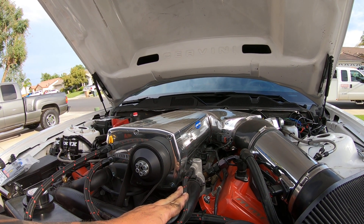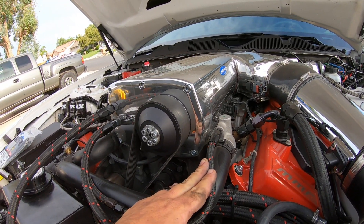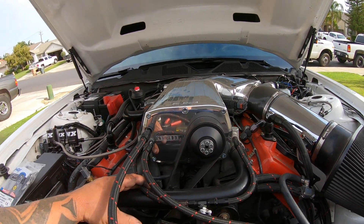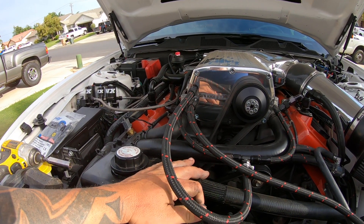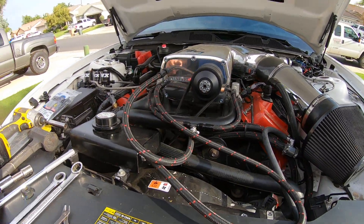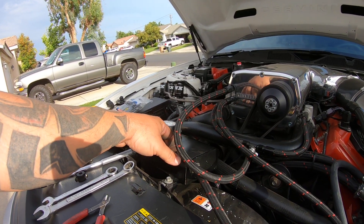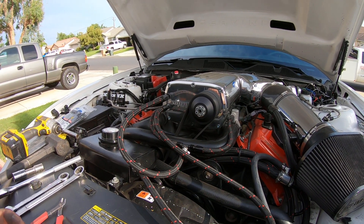I know Revin Racing - revinracing.com - he sells a kit that you can do this with, so you don't have to drill and tap. I wouldn't do it with it on the car personally. You could if you drain it and take these off, but for all intents and purposes I would do it with it off. His kit means you don't have to drill and tap it - he sends you everything, I think it's like 150 bucks, and you get nice hoses with it. You still attach it right here with some heat shrink or a clamp. So now the liquid cool part will be cooled off the reservoir - yes it's going to be a little hotter but that's what has to be done. They say don't run ice through there, so I'm not going to. Now I can run ice in the tank when I'm at the track.